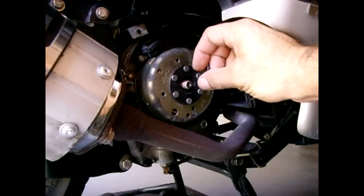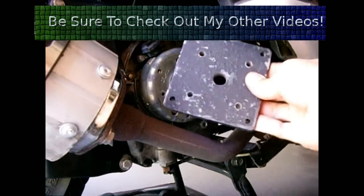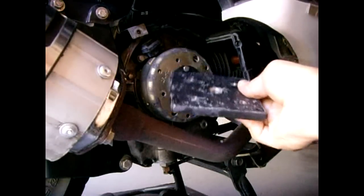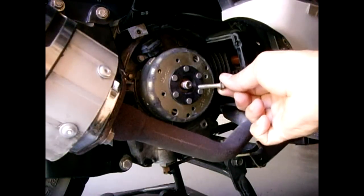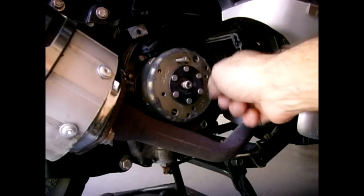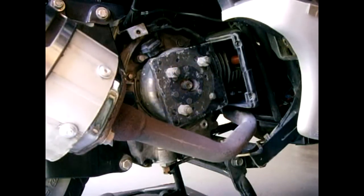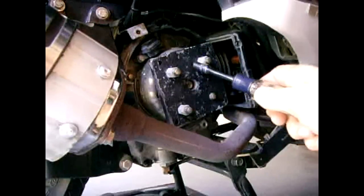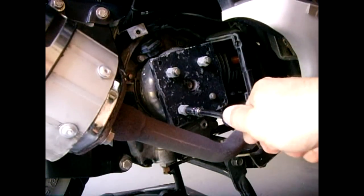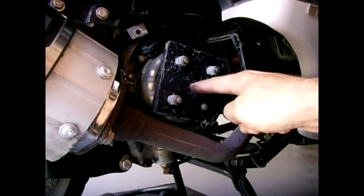You put four bolts into these holes, then take this plate, put your bolts through the holes, and secure the plate down tightly into the holes where the fan blade was attached, using around one or one-and-a-quarter inch long eight millimeter bolts. This is very thick — you're not going to be bending it. I've taken this off a bunch of times with no problems. The plate is now secured. I added a couple of 5/16 nuts to make the bolt not go in as far into the flywheel. Tighten this down good and now I have a good area to use to pull while pushing on the shaft.